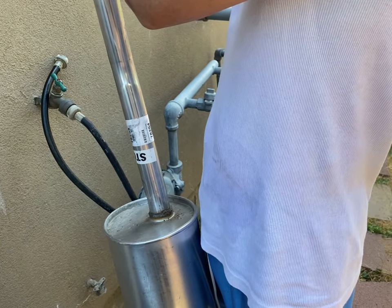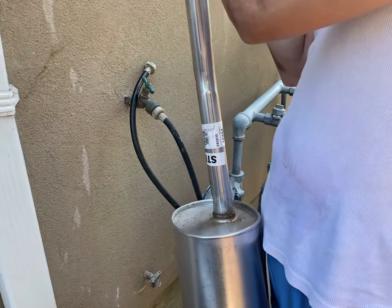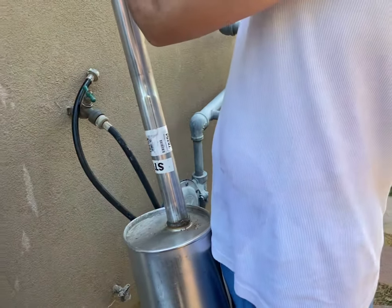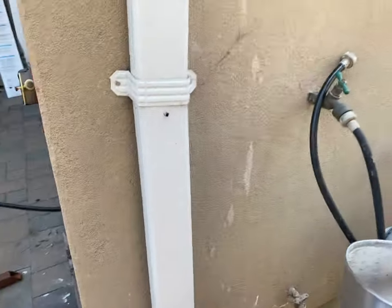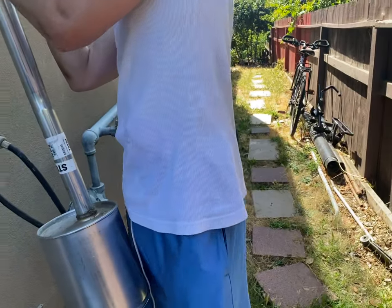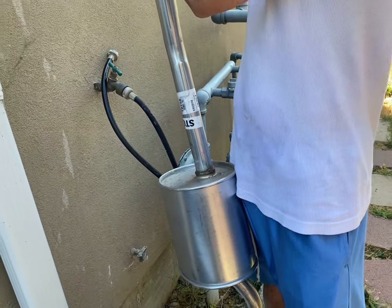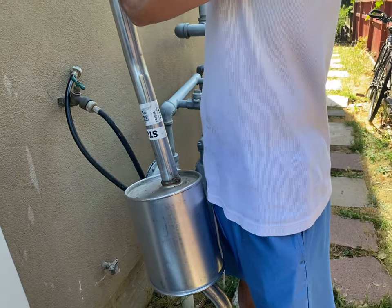Don't measure by the tool, measure by the fit. As long as this gets close to the other side I can weld it — the closer the better. Then tack it, and then we'll get Eddie to weld it. We'll probably drop the whole exhaust to the ground again, because you get better articulation and a better seal that way. You also have to clean the inside because you can't have contaminants in there.